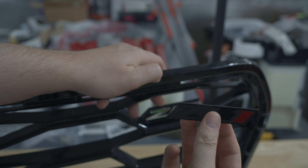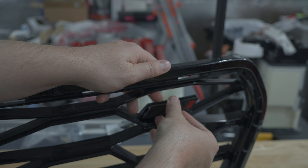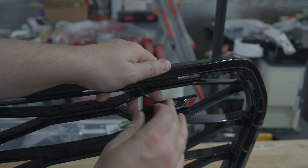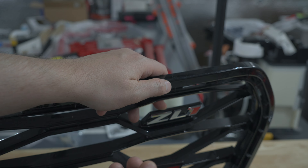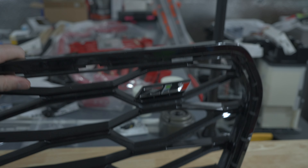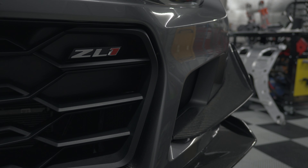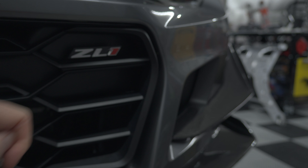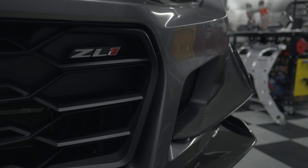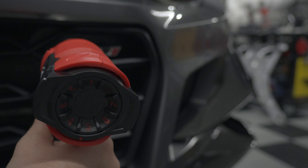You're going to want to make sure you pop these off straight towards you because of those alignment pegs — you won't be able to peel to the side. Once all that's off, note that the Laser Creations emblem does not have an alignment peg, so when you install it, just line it up as good as you can. You don't want a crooked emblem. Get the adhesive a little bit warm, peel off the backing strip, press it down, hold it for a few minutes so it's nicely bonded. You don't need to take your grille off the car to do this.